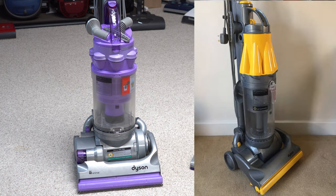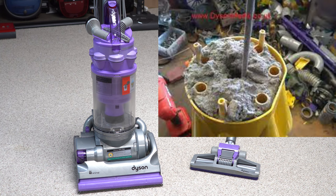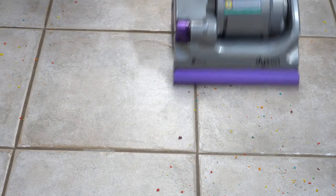If you've never seen an 07, what happened was that the cyclone basically had to fight gravity, and the holes were too small. Originally, the cyclone didn't have a lock on it, so customers were picking it up and dropping the vacuum down the stairs. There were actually about three different revisions of the DC-07. It was clear that the cyclones needed improvement, and they came to the DC-14, which shares most of its parts with the 07 — it's like an improved 07.